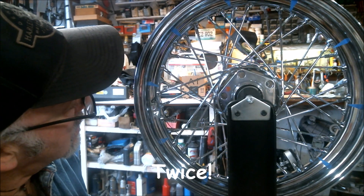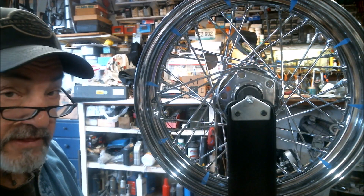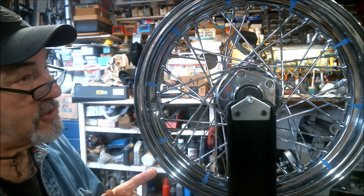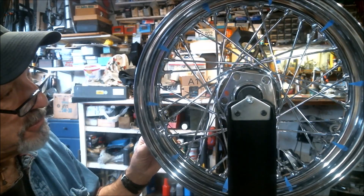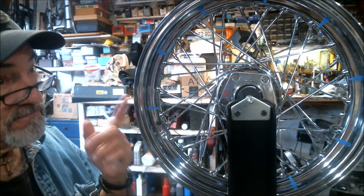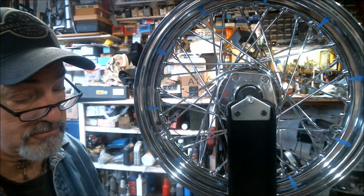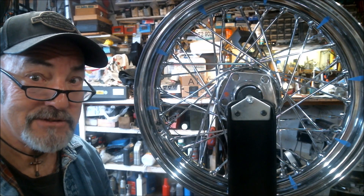Make sure these are all at the bottom limit of that 40 to 50 inch-pound specification. That's once around on this side. The only thing is that every spoke causes tension or looseness on every other spoke in the wheel, so I really should go around each side again. That would take a very long time, but I'm retired, so maybe I'll just go ahead and do it.